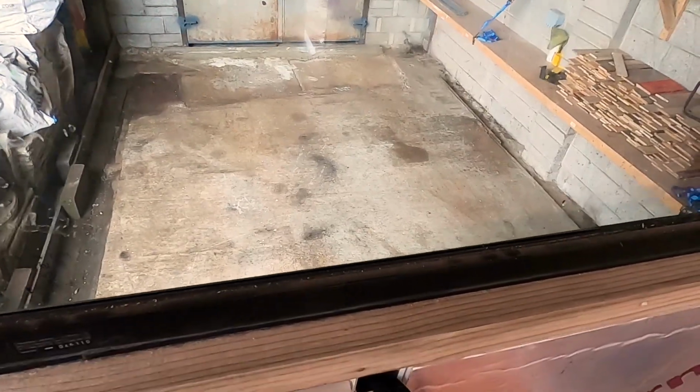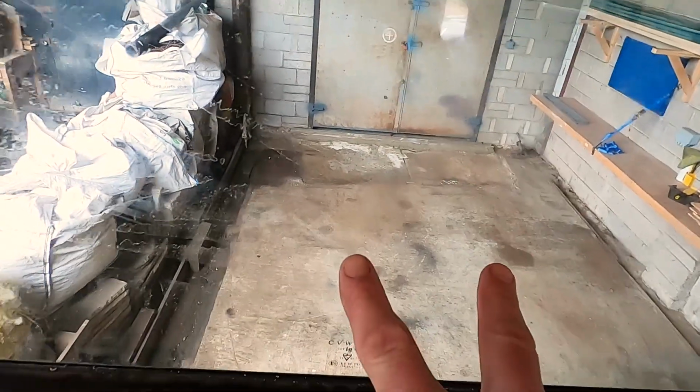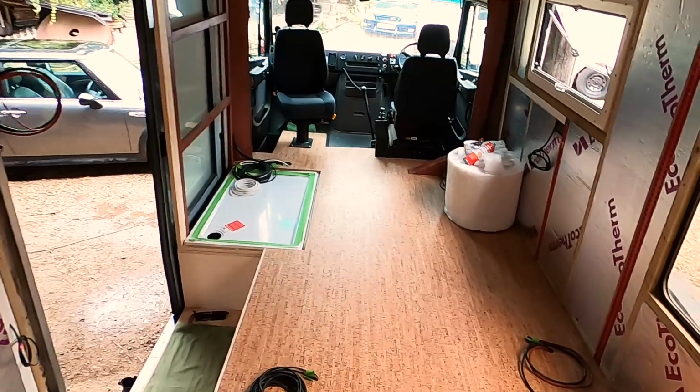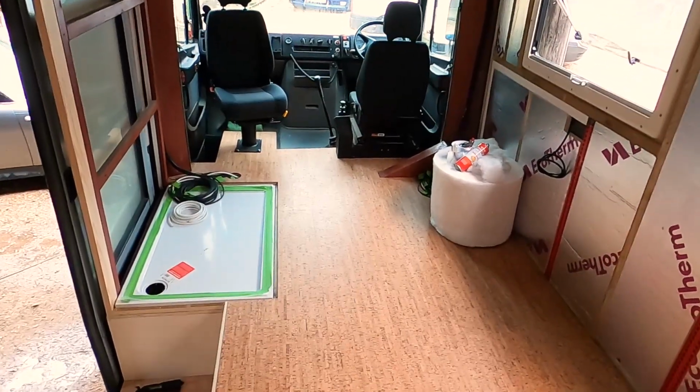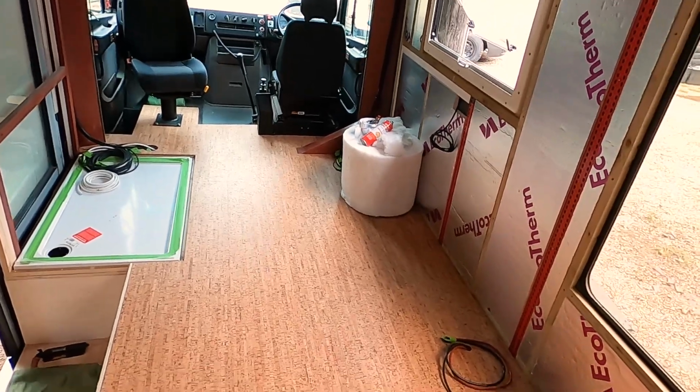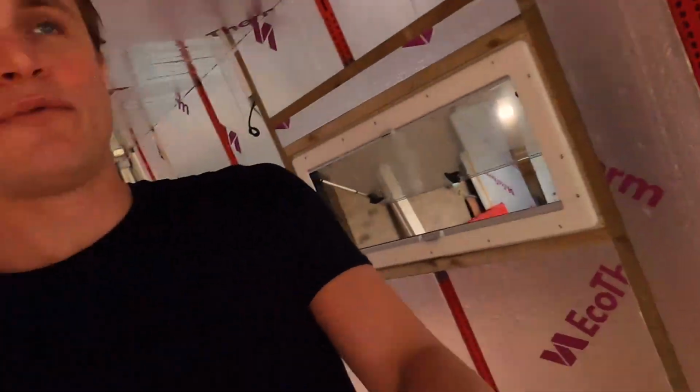This has all been PVA'd, so the new concrete will be able to bond to it, and it will be fibre reinforced concrete as well, so it'll be super strong and crack resistant. So this will be lovely and smooth. There'll be a 2-post lift going there to put a car underneath and a car above that car, to give us a bit more space out in the yard. We're not blessed with having an enormous car park outside, but again, I love this spot, so it's got a lot of character, which I think is in keeping with what we do.